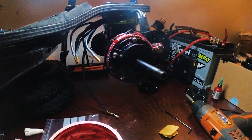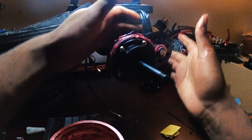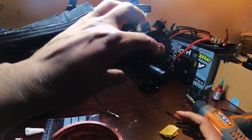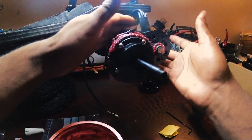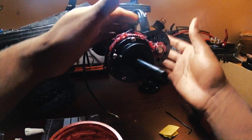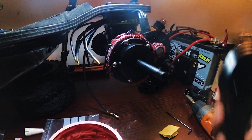Once you've greased the pinions, roll the motor by hand to distribute the grease. The clicking sound will disappear because of the added grease — that's normal and doesn't mean the backlash has changed. The grease simply minimizes wear and tear on the pinion teeth over time during riding, acceleration, and hard braking.